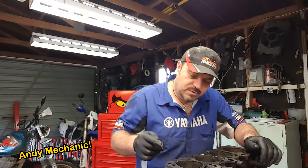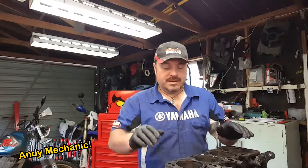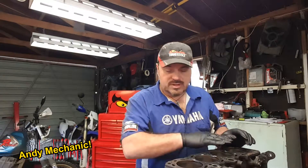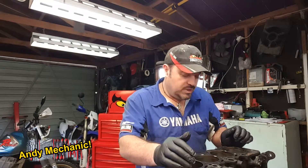Unfortunately we've got five positions where the top of the block is lower than what it should be — there's clearance, and there shouldn't be. It should be dead flat. That's probably most likely due to the engine having overheated at some point, and things do warp when they get too hot. So this block is going to need to be skimmed and flattened down again so it's nice and flat and within spec.